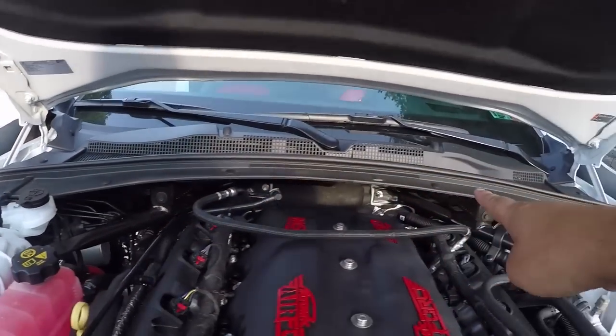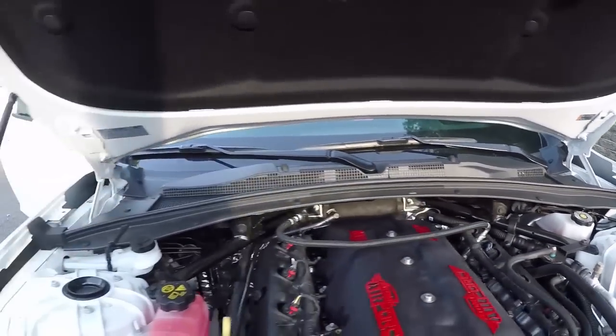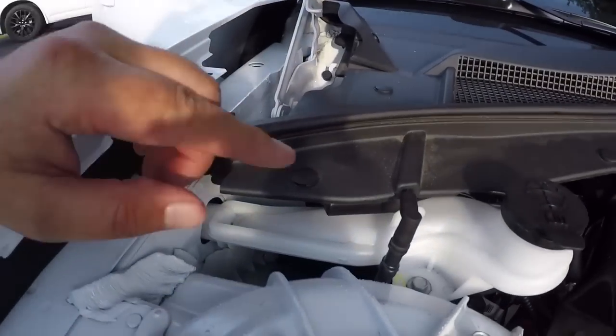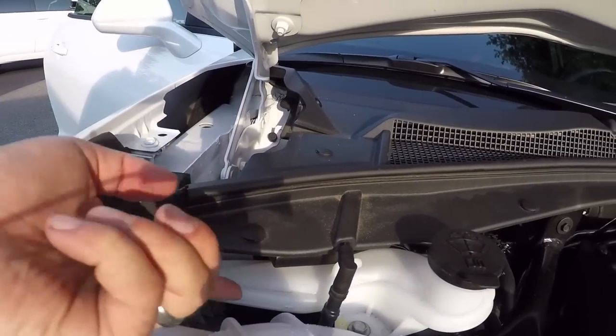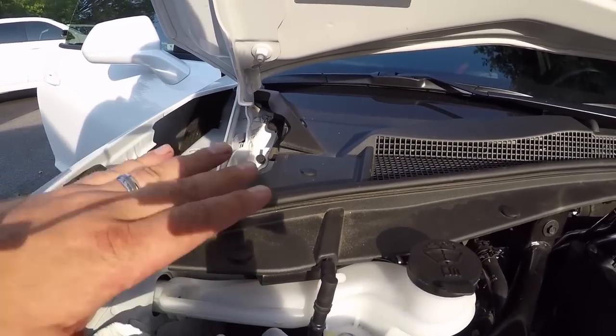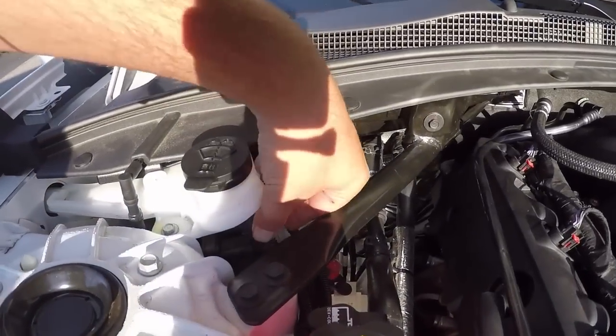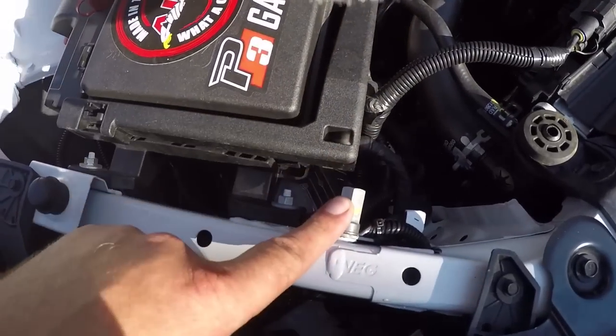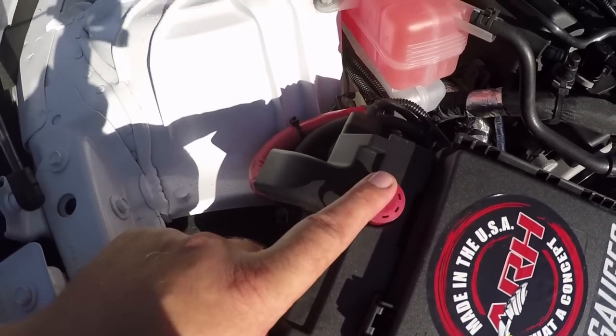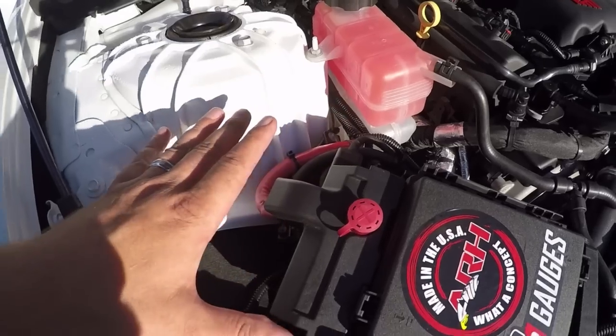The carbon dash is done and I'm super happy about that. I just want to do a quick overview on my LED light system under the hood. What I did is put the four-inch strips underneath the back plastic piece, and I put the module right here above the washer bottle so it's out of the heat. I was able to use a push pin through the hole in the module to hold it in place — nice and secure. I took the wiring, followed it along the factory wiring, looped it around, with my ground on the ground terminal for the boost point and my power on the bottom side of the boost point for the positive.